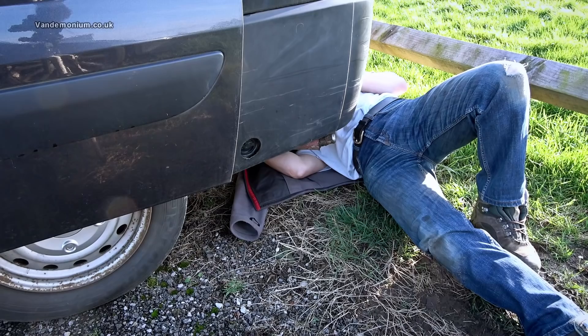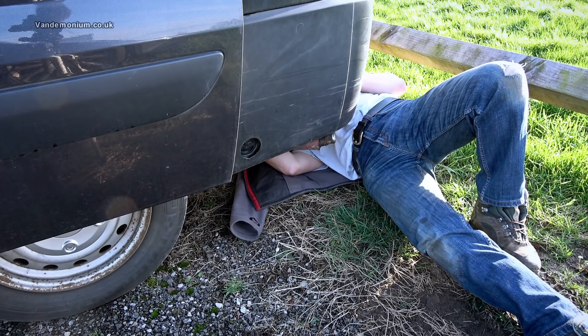Let's check outside. Even allowing for inaccuracies in this thing and variances in where I pointed it — and I know people told me that what I'm actually pointing at will make a difference as to how reflective it is — it seemed fairly consistent that the temperature coming out the bottom of the unit is about 140 Celsius. It fairly quickly dies off down to about 90 to 80 as it goes along the pipe, then 60 as it goes out the bottom of the van, and by the time it got right to the tip of the exhaust it's only 30 Celsius. So basically the stretch coming out the bottom of the van, the first few inches, is 60 to 50 degrees.